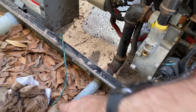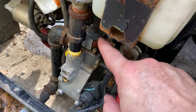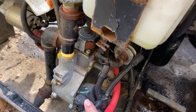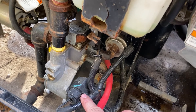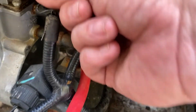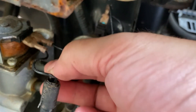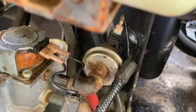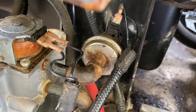If you look right here where the fuel comes in — here's where the gas comes in, into this control unit here — there is a fuel solenoid here, and then there is an auxiliary fuel solenoid here. This is FS and FS2 in the manual diagram. What we need to connect to is wire number 14, which connects the fuel solenoid. But the wires connecting the fuel solenoid don't have a label indicating wire number 14 — it is not there anymore, or maybe it was never there. So I'm just going to figure out which one of those is ground and hook up to the other one.